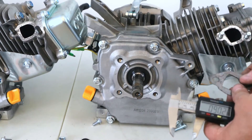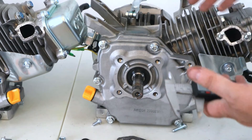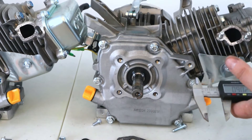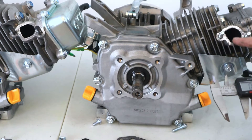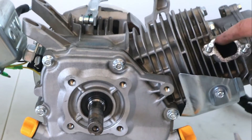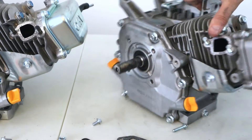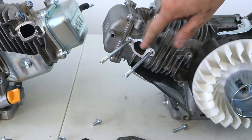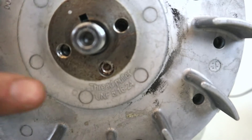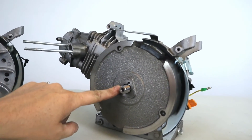Port matching on your gaskets, headers, and intakes is actually a pretty easy thing to do — just shave that interior out. Stocked without any changes, the Predator engine has about a .02 difference — larger size for both ports. If you look at the exhaust ports, the Predator's exhaust is a little bit larger, and the same goes for the intake side. If you have a threaded puller, you can use it on the PVL flywheel. The Predator engine flywheel is going to be a little tricky to get off.